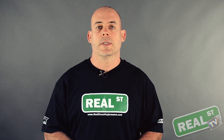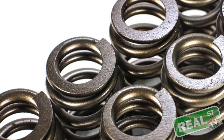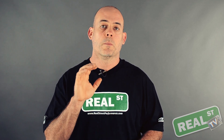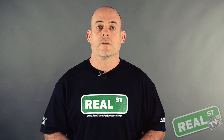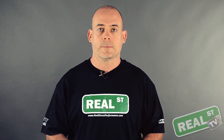When the question comes up of why you need an upgraded spring, it's pretty simple. The factory springs were designed for a certain lobe speed and a certain engine speed, and most of them were designed without boost on the back of the valve. When there's boost pressure present on the back of the valve face, it's actually pushing on that valve, which directly decreases the effective valve spring pressure available. So if you've increased boost or engine speed, you're going to want to look into getting an aftermarket valve spring set.